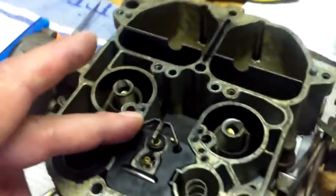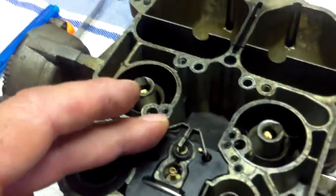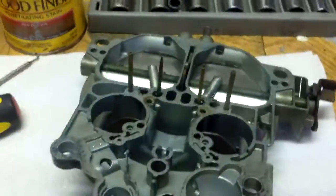Now here's the difficulty. These little metering rods are extremely delicate and fragile, and when you want to put your carburetor back together — after having changed jets, adjusted floats, cleaned it, etc. — you have to reinstall the air horn. The trick is to install the air horn without letting this sucker pop back up.